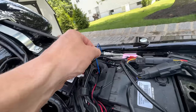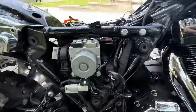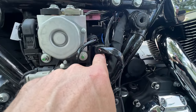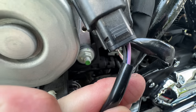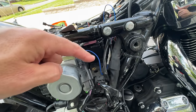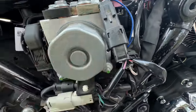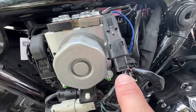I backed out that blue wire — it's not on the left side, it's on the right side right here. This is the connector and it's sitting right under this connector. It has a black wire and a purple wire going to it with a dummy plug. You take that out and plug in the blue wire from the Ultra Cool kit. This is the accessory power and I double-checked it with my volt meter once I turned on switched power.